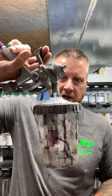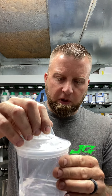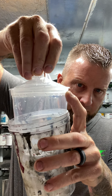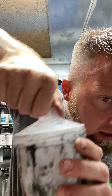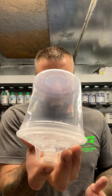If you turn these guns upside down and pull the trigger, it'll vacuum everything out and come out. When you guys fill up your cups, don't fill them all the way up to that line — that line is designated for that lid to snap and spin. If you fill it past that, you're going to bust fluid out and it's not going to lock. Once you get your cup in there, you put it in, listen — it snaps — spin it a couple times, then pick it up. Now you're good and solid.